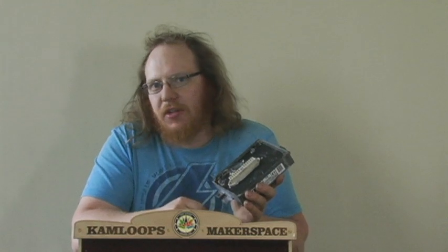It's not like a modern engine computer where if this box dies, the vehicle doesn't work at all. In reality, the vehicle is going to run like absolute crap because this thing is doing a little bit more underneath the hood. Back then everything was carbureted. At its base, once the vehicle warms up, it looks at the O2 sensor to check the oxygen content of your exhaust gases — modern cars still do this — and determines whether your carburetor is running too lean or too rich. As a result, it feedbacks to the vehicle's carburetor, usually made by Carter, to pull a set of pins in or out to control the lean or rich mixture of the air-fuel ratio going into the engine.